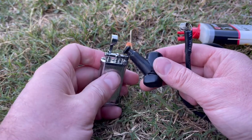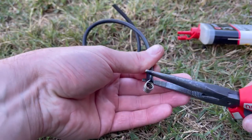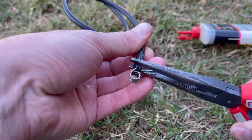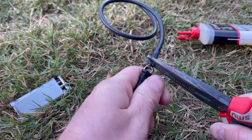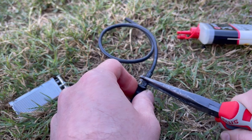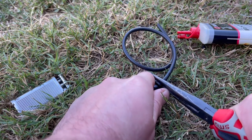The last stage is I'm going to warm this beginning part of the boot up with a cigarette lighter. Now I'm going to take my pliers and hold right up to the end here — I'm squeezing down this way, not squeezing sideways because the barb can still spin. I'm supporting it here, then I'm going to take this boot, hold it in my hand at the bottom and top, squeeze hard with my pliers, and wobble it in. Push that in, then pinch it, go back slightly with the pliers and push again. Just keep feeding it in — nearly there. There we go!